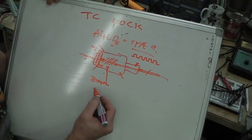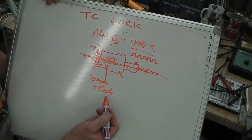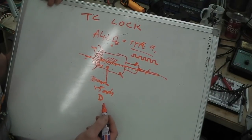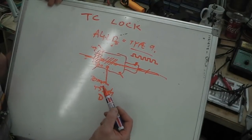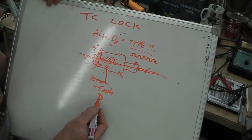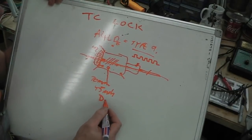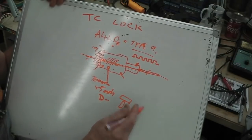And it seems to be that the going rate is 45 miles an hour to bring it online. But only when you're in drive. You don't want to bring the lockup on when you're in any other gear. It's designed to work, in this case, on cruising conditions or near cruising conditions. So you really want to be in position D on your T shifter for the torque converter to be allowed to come online. So position D on your T shift stick.